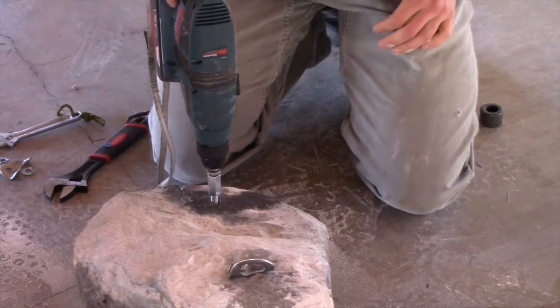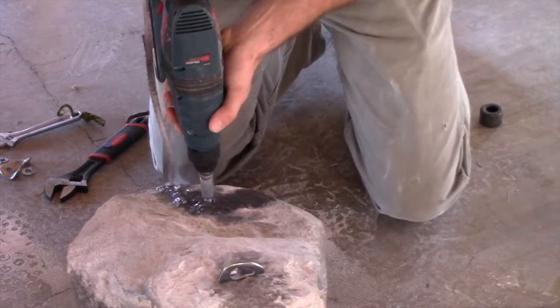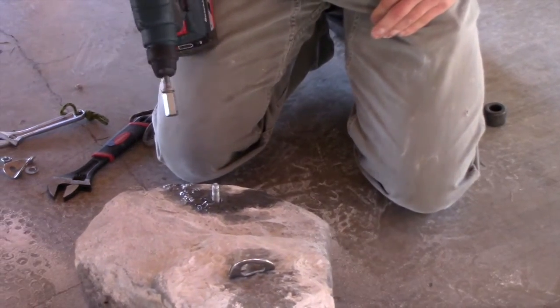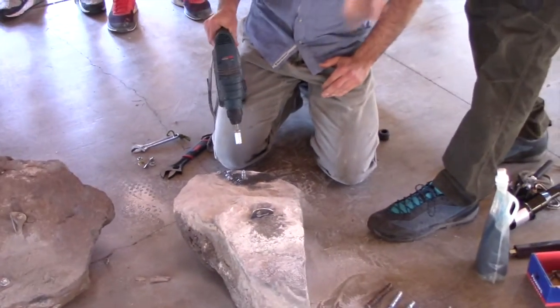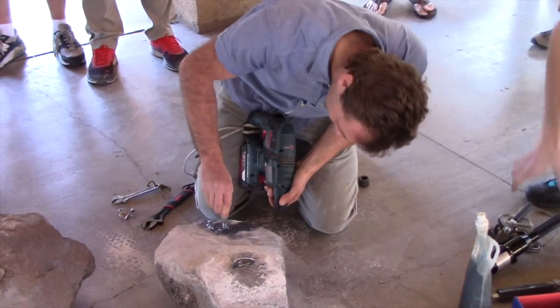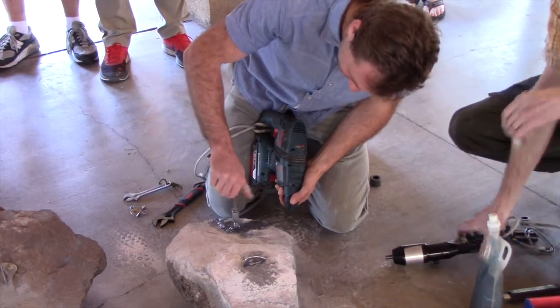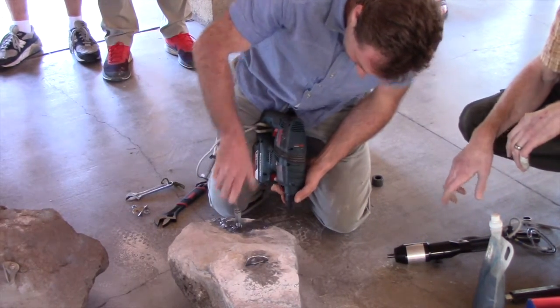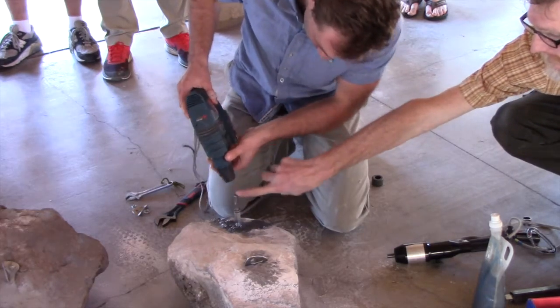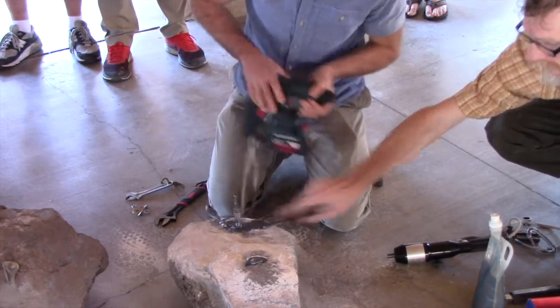Okay, that's probably enough. Put the drill in reverse — pull out hard and pull the trigger. So that takes it off. Actually, sorry — I screwed up. Put it back on because we're going to use the spinner tool to do the pulling as well. Use two crescent wrenches to take the SDS portion off of the coupler — unscrew this from this.